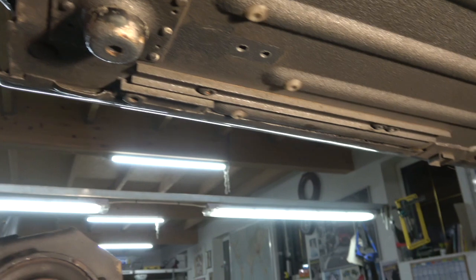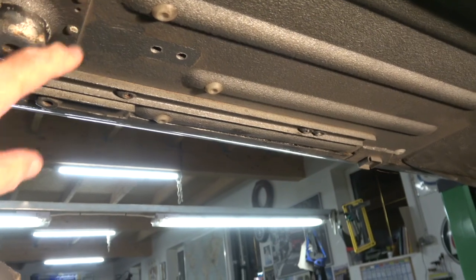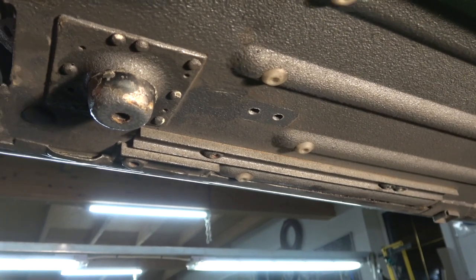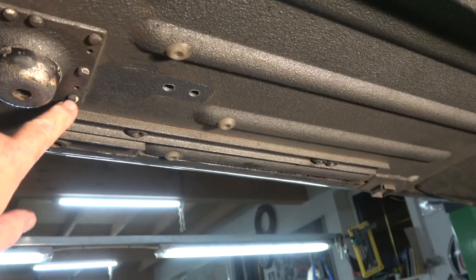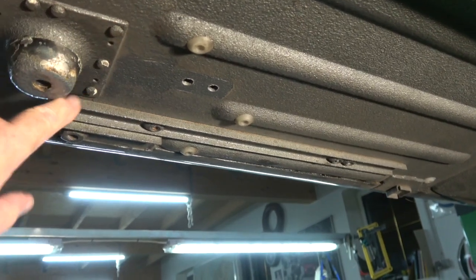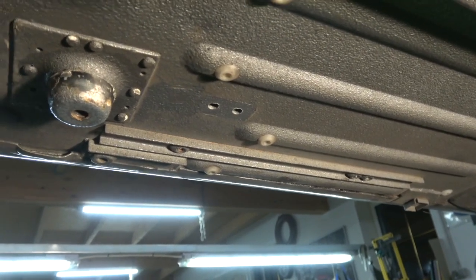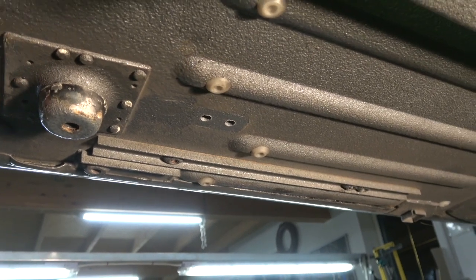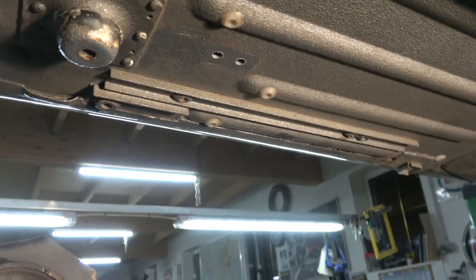So for those of you who are not aware of it, these cup mountings are made so that they shear from the car. I know it might sound a bit strange, but they're actually cold riveted. They're not welded to the car, so whatever you do, don't weld on them. They're just cold riveted. And when I bought these floors, I had Martin Roby put them in for me, so they were in exactly the right position on a jig. Because if you had to replace these, they need to be absolutely spot on. Otherwise you'll find it very difficult to get this arm back in.